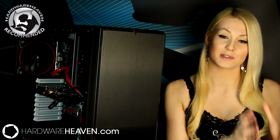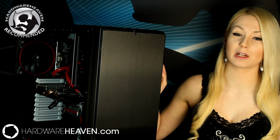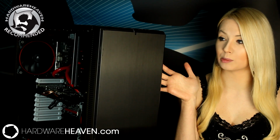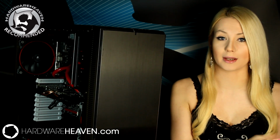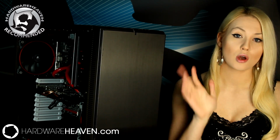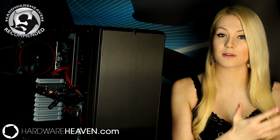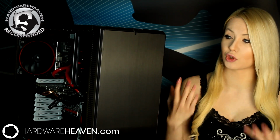Or if they targeted specifically the water cooling enthusiast, made it so it had support for a 360mm rad in the roof by going into the optical bays, and just fit a modular vent. So you've got a choice by either using the optical bay with the modular vent or removing the modular vent and being able to fit a 360 rad in the roof. Or like I said before, offsetting the fan mounts like they did with the Arc Mini to allow for a thicker rad in the roof. So I also feel like they've missed an opportunity there.